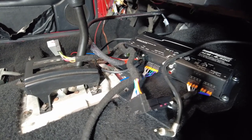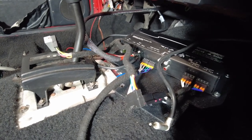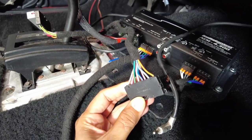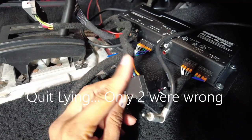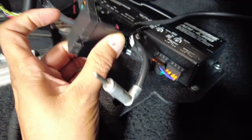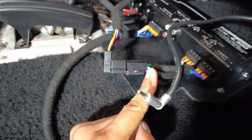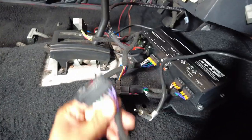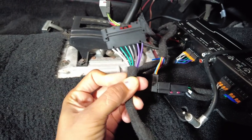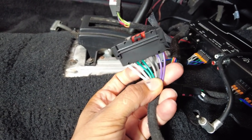So you're ready to power up your sound system and it sounds like boo-boo. Well, the reason it sounds so bad is because from the factory these pins were not right. I actually had to repin my entire pinning because the orientation did not match the aftermarket orientation. Which is funny because the aftermarket orientation matches the radio's orientation perfectly. The pins on the back of the factory radio — this is the correct way that it's supposed to be in sequence.